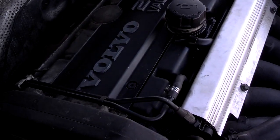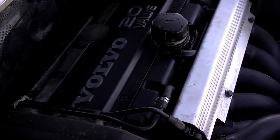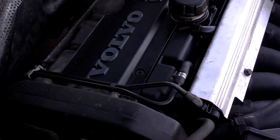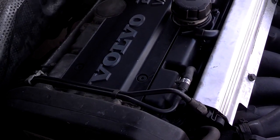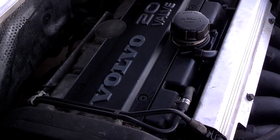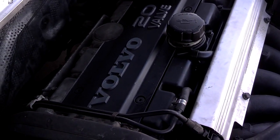Now, because your spark plugs are removed, hopefully most of that water, fuel, whatever, has been ejected from your cylinders. Now you need to dry out those cylinders from fuel, water, whatever's in there, because your combustion chamber needs to be pretty much dry in order for your car to start. So you let that stuff air out for a few hours, or you blow compressed air down in there to try to air that out. At any rate, you want that area dry and free from water, especially. Hopefully there's nothing in there left but fuel.